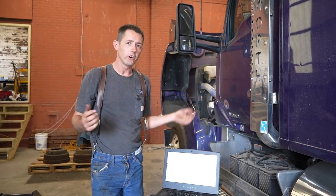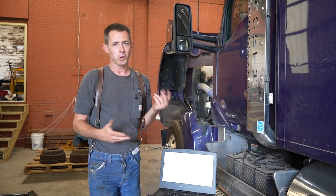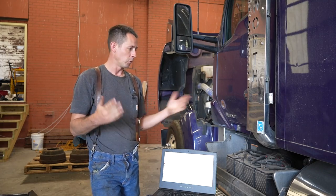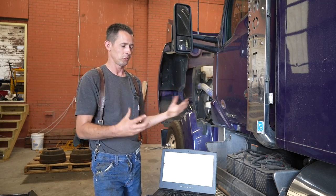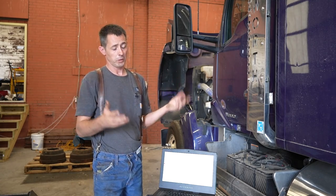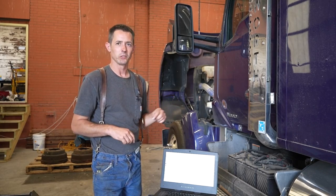So as you saw, we just started the truck up without the downpipe hooked up to the DOC — and thus the DPF and the SCR system. This was for testing purposes. I don't know what it would do going down the road, and obviously it's not going to be legal by standards and all that. But they will start up and run. It has a lot louder sound, and a lot of that smell of a real diesel — you know, pre-emissions diesel. You have that smell here in the shop without that hooked up. So the DPF with the emission system — the DPF, SCR, etc. — they do run a lot cleaner, because usually it doesn't burn your eyes when you're in here running the engine.